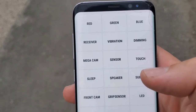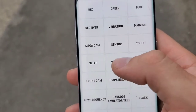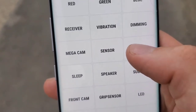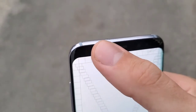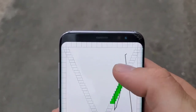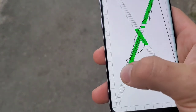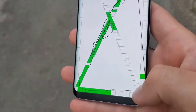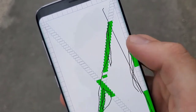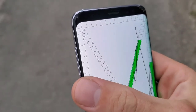Most importantly, you can also test your speaker — it will play a sound. And then also very important to test your touch. You go around with your finger and draw on the screen. There's a big X and you draw across the whole screen. Wait until it goes green, then go around the whole perimeter of the screen without missing anything. Once it's done, it'll return back to all the options, which tells you your whole screen is working, especially around the perimeter.